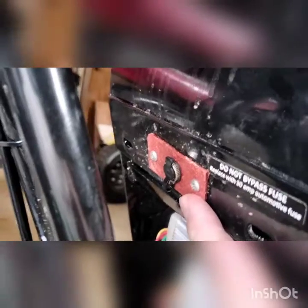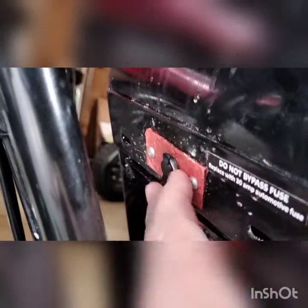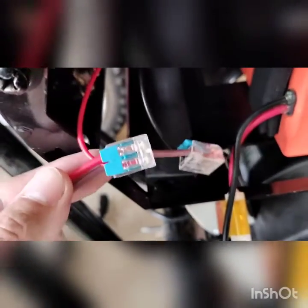Here's the factory Greenway wires. I pulled the factory charge port out, which looked like a computer power plug - the little three prong thing. I didn't have any plastic or metal so I just used a piece of wood for the charge port. I'm using a barrel plug with a regular Amazon charger. I never tried these wago connectors before so I thought I'd try them - this is low amperage, they're rated up to 32 amps, and the charger is about 1.5 amps so it'll be fine.